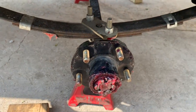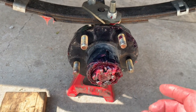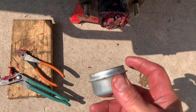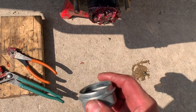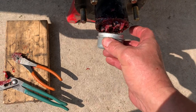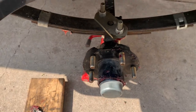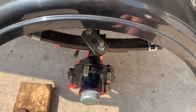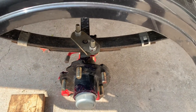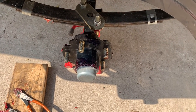Get your cap and tap it on with a rubber mallet. If it goes on loosely, bend the little ends of the cap out — smack them with a ball-peen from the inside out to make them come out so they fit on more tightly. Use a rubber mallet to put them on. Your wheel bearings are done. Put your caps on, snug them up, put your tires on, and torque your lug nuts to 90 foot-pounds — or 90 to 100 depending on your tire type. And that's how you repack your wheel bearings.